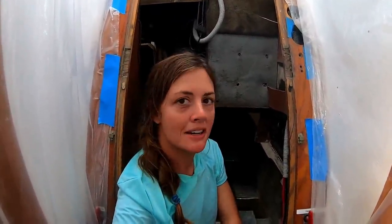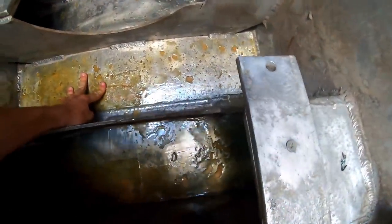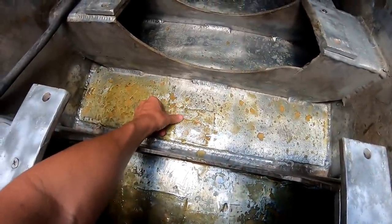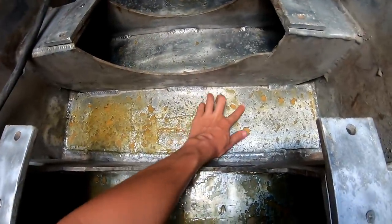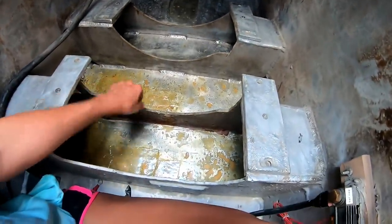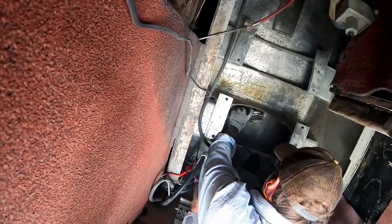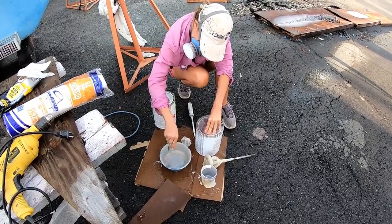The engine has been collected so it is on its way. In the meantime, all we've got to do is finish prepping the engine compartment. We finished our epoxy — it looks pretty good. We've got fiberglass over the really bad spots but luckily there weren't many, and all the other holes have been filled. We're going to sand this and paint it with Emmerlock, which is a two-part epoxy paint that bonds very well to aluminium and other metals.